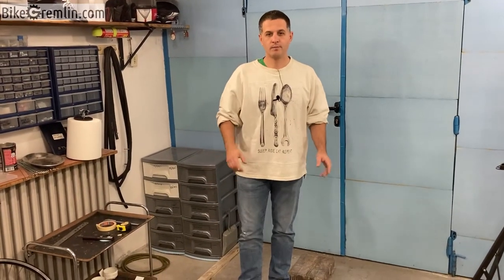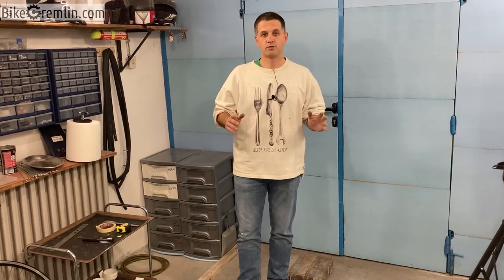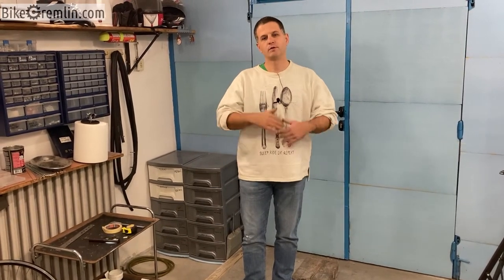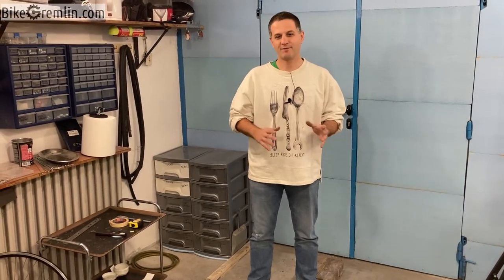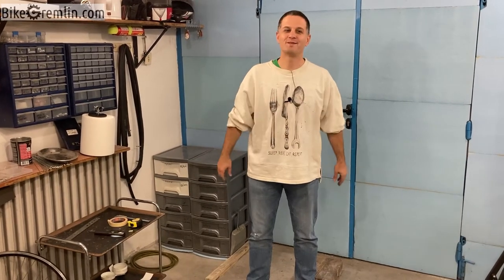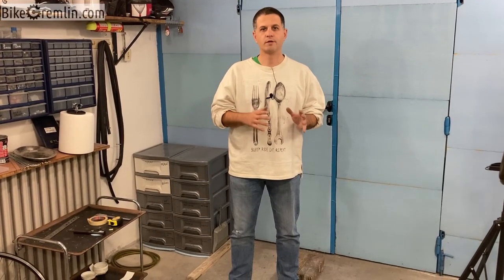When I measure rims of this manufacturer, it usually measures 592 millimeters. I will unlace this wheel and measure it, and if it turns out that I have somehow made a mistake, I'll write a comment below the video. But this method usually gives relatively accurate results if you do everything carefully and with patience. It's not perfect. It is a lot easier, a lot faster, and I would say more accurate and precise to measure a rim without any spokes when it's not laced.